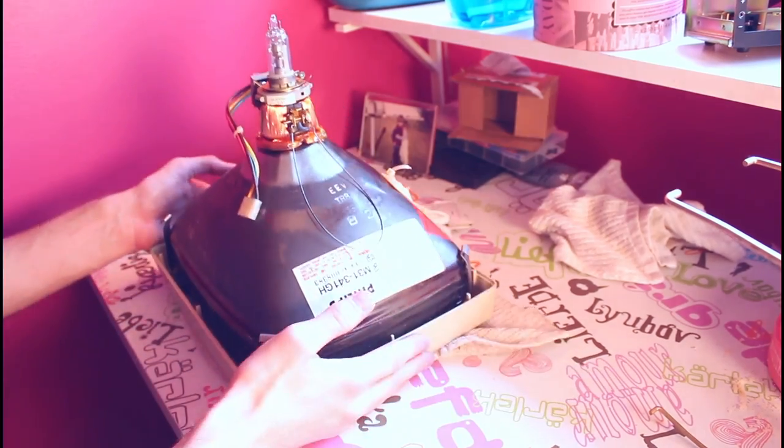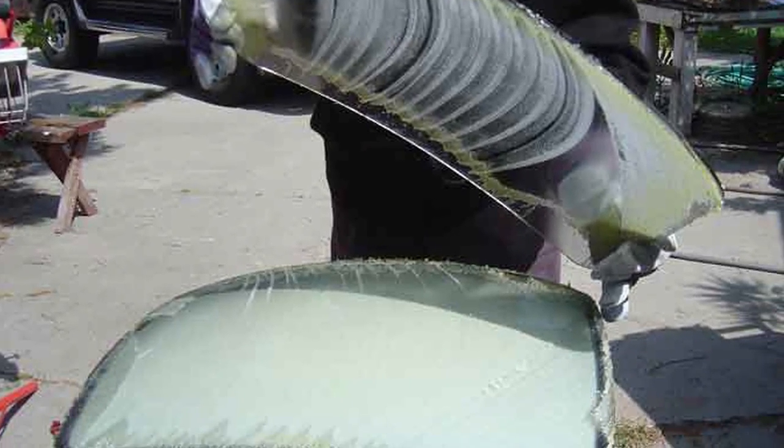Now, what is CRT cataracts? Older CRTs were constructed in a very interesting way — you had the actual CRT and the CRT protection glass. The protection glass was glued onto the CRT to prevent any glass flying at the user's face if the CRT imploded. Because flying glass at your face is bad. So over time, the adhesive bonding the protective faceplate to the CRT starts to weaken, and you start to get bubbles underneath the screen, also known as CRT cataracts.